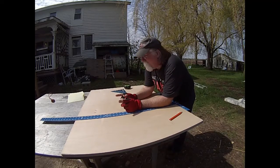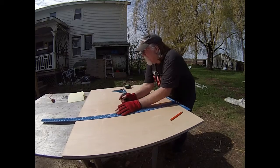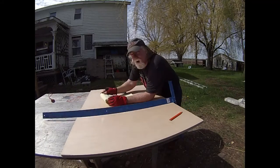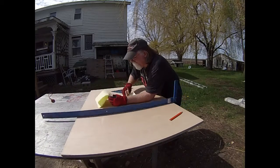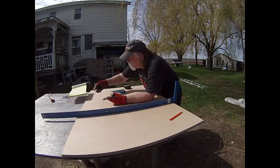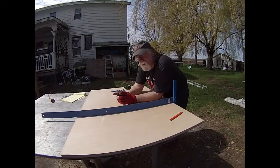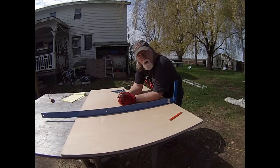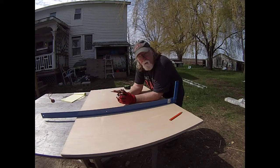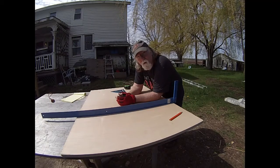The countertop is 22 inches, 21 inches. I got to have notes. Countertops, 22 inches. What? These are going to be 24. The reason for that is the windows on the bus are 28 inches high. This is going to be 35 because that's comfortable working height for a counter.